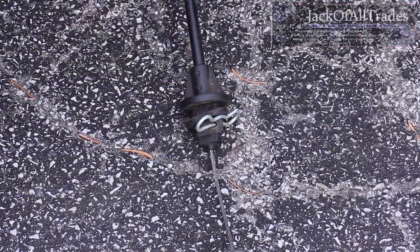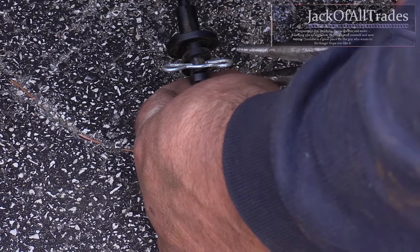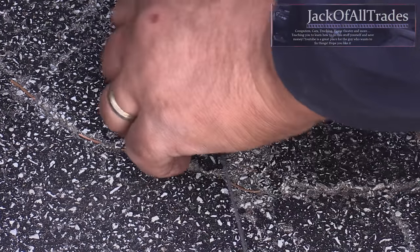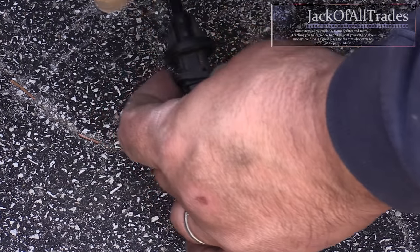This is the cable that engages the blades. You're going to want to remove the cotter pin — just like that, a pair of pliers will work. Once that's done, you're going to remove the sleeve right there — just pull the sleeve down, just like that.